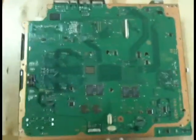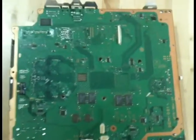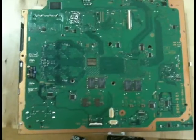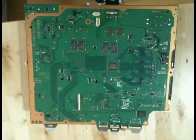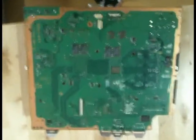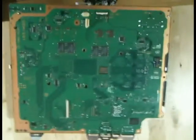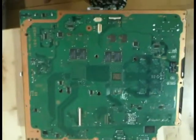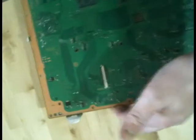If you need to flip it over and use gravity to your advantage, you can do that. You might need to pull on it a little bit — don't use too much force, make sure you've got all the screws out. I kind of had to work that; it took me about a minute to get this to break free. These motherboards are actually pretty flexible, so they can get a little bit of bend in them. What happens is the heat conductive material between the processor and the heat sink will bind together and stick to the actual processor itself, so you need to break that bond, which can take a little bit of muscle. Once you've popped it, this thing will just pull straight up and lift off.